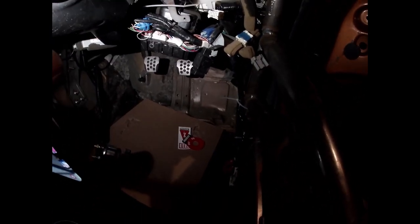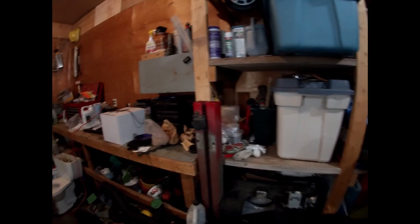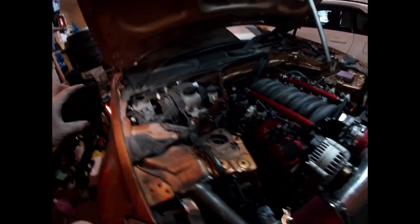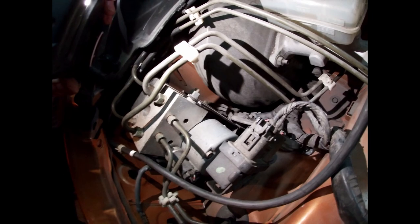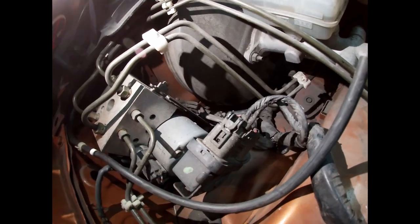Got to make sure my gas popper is accessible and that all that stuff is out of the way so I don't hit it when shifting gears or going for throttle — it's pretty tight in there. Once I get that shimmied up, I'll put the gas pedal back on and run the throttle cable. I'll need to drill a hole in the firewall because this is factory drive-by-wire and I'm converting to drive-by-cable. Theoretically it'll come out somewhere in that vicinity, so hopefully I don't drill into anything — I'll take my time and figure that out.